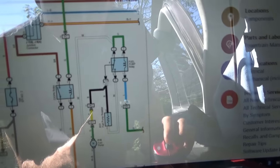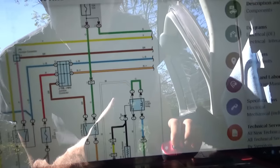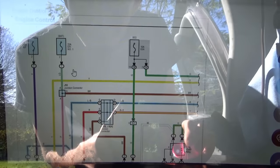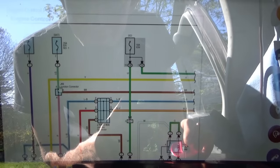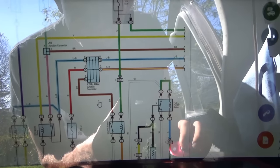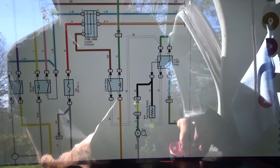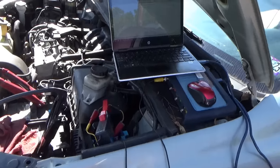Okay, so we want to set up a current measuring device. Let's pull out the 25 amp EFI fuse, install some jumpers and an amp clamp, and use the PICO scope to monitor current over time. First we'll do key on and see what the amperage is. We'll try to start it and see if it spikes to something crazy. If we see something weird, we can start isolating the circuits. We'll focus on the fuel pump circuit and see how much current the fuel pump draws. That's my game plan. So let's get started.